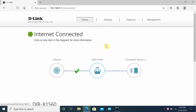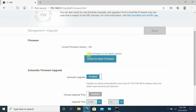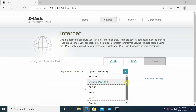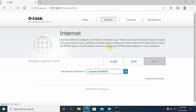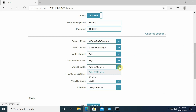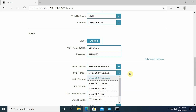When I tried to access the wireless settings, the router crashed and I couldn't connect to any settings. After troubleshooting I had to reset the router and found a newer firmware available — the factory firmware was version 1. If you buy this router, the first thing I'd recommend is upgrading to the latest firmware. All tests in this review were done with the latest firmware. After updating, I was able to access wireless settings with plenty of configuration options including WPA3, manual channel selection, and advanced settings — which is a big plus, though non-power users can leave everything at default.